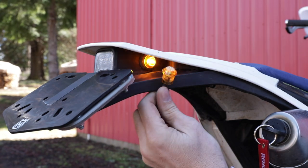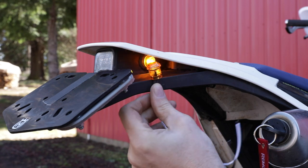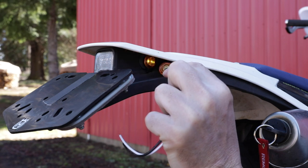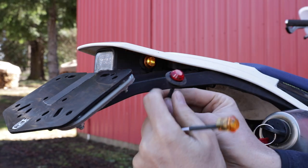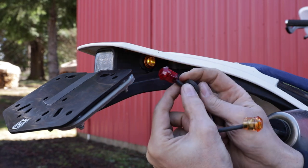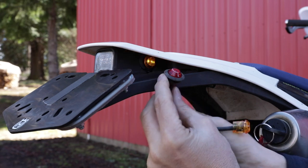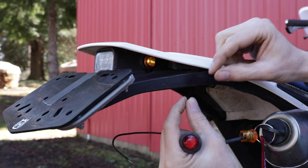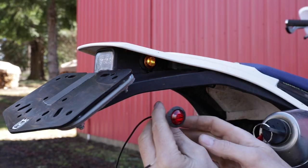What I did is I found these little tiny three-quarter-inch LED lights — they've got three LEDs. I think they're used for trailers or marker lights, but they're really good quality, really affordable, and they're all potted and sealed in there. It's impossible for water to get in. They come in a really nice rubber grommet — you drill a seven-eighths-inch hole, and the light comes out with tape on it. Really nice quality. They're isolated with that rubber mount. If you do happen to break one, it's just a matter of popping it out and unhooking the wire. I got the original Japanese Honda-style connectors, so everything would be easy to replace.